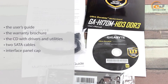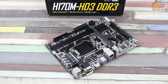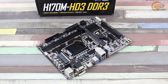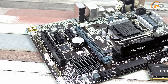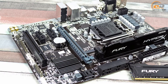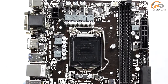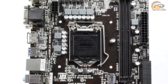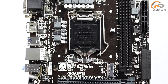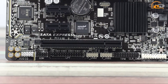The motherboard supply set is as follows. The new product is based on a Micro ATX printed circuit board with a reduced width of up to 174 mm. Its design is rather strict and restrained with very soft colors, which is generally consistent with its declared price point. As for the onboard component layout, the location of ports and connectors won't hinder the system assembly. Although the DIMM slots are equipped with latches on both sides, they have sufficient distance from the video card slot, and the SATA 3.0 and SATA Express ports are parallel to the board surface.